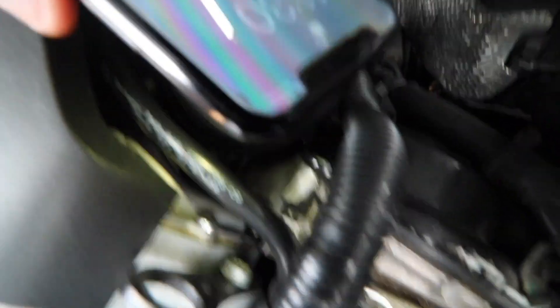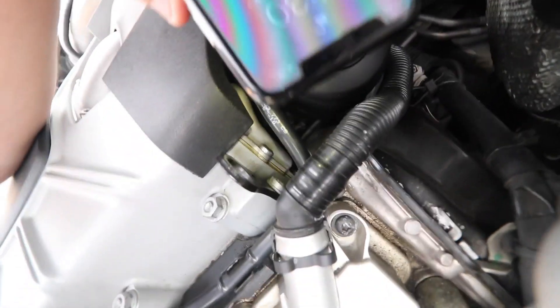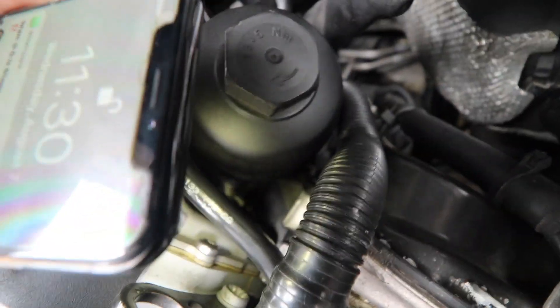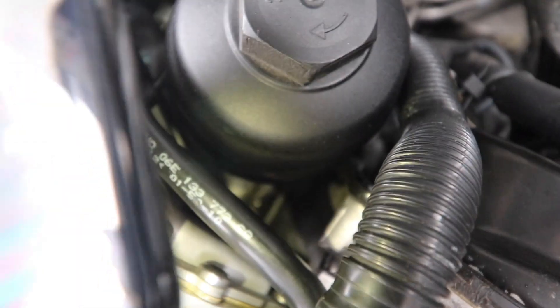I started to look underneath to see if I'm losing coolant through the intercoolers like I was last summer. Unfortunately it's kind of hard to tell, but down underneath the supercharger you can see some pink coolant down in there. That might be the end for the supercharger or the PCV system, because there is coolant that runs through that valley. Last time I did replace the whole supercharger — I bought a used one with only 30,000 miles, the intercoolers were still intact, I pressure tested it and everything held pressure great, and I also put in a new PCV system and thermostat. At this point I'm not sure which is the exact failure point.